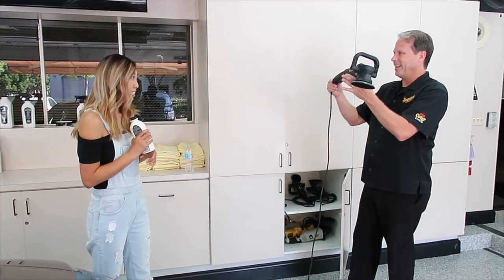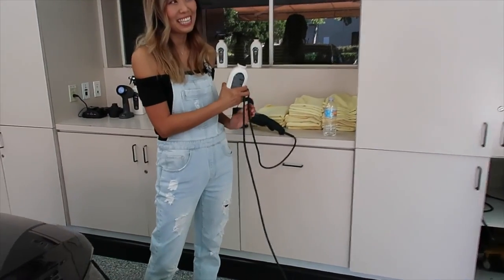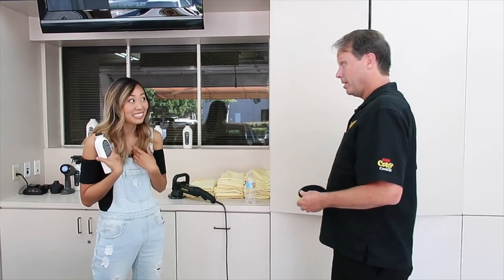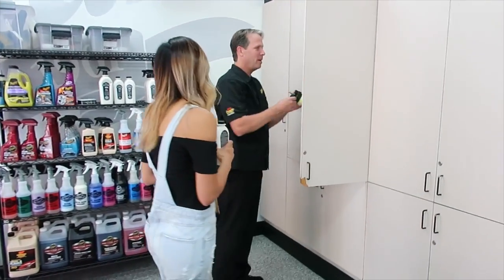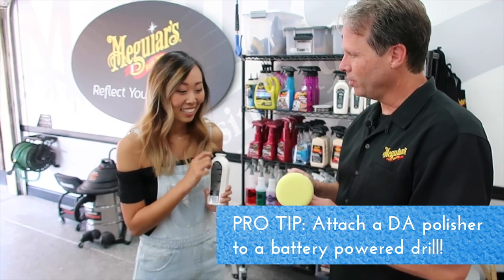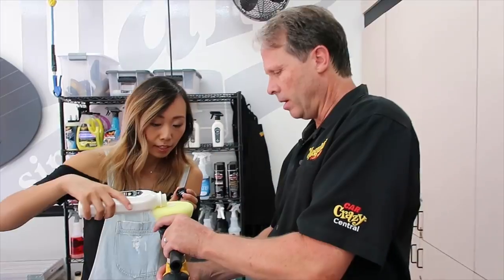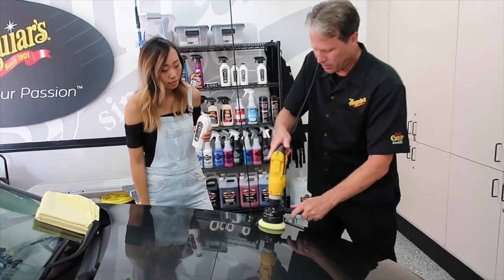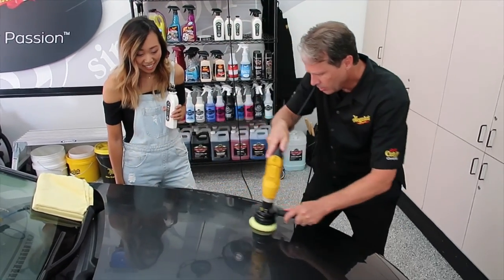What we're going to introduce you to is a DA polisher — don't be afraid of it. Even better, you can grab the same DA polisher and put it onto a battery-powered drill with a couple of spare batteries, and this becomes automated. Put a little bit of product on there, put the cord over the shoulder, and you're just spreading that product with an overlap, just like you're working by hand.